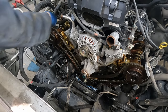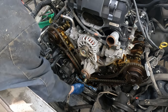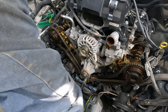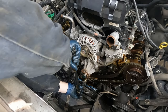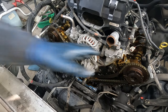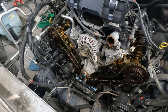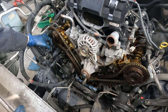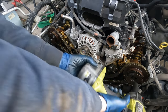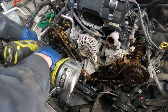We'll be taking off the right hand side first. This is our tone ring for our crank position sensor. Put our crank pulley bolt back in so we can spin the engine - just snug. The keyway should be at 12 o'clock with our timing marks pointing straight up. On the left hand side there should be an L with an arrow pointing up, and on the right side just a tick mark. Some phasers may have an R on the right hand side.